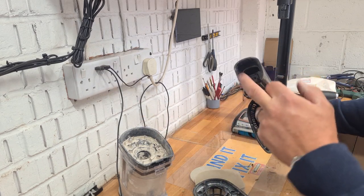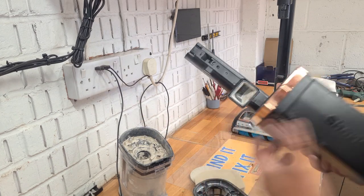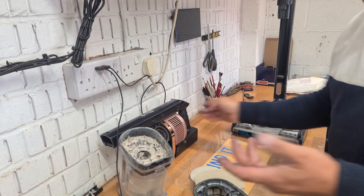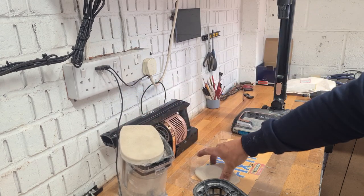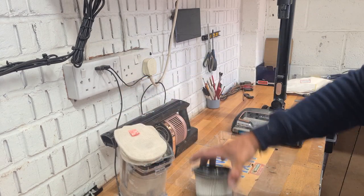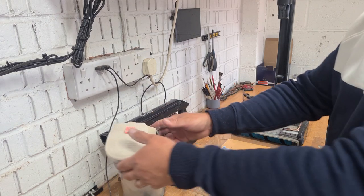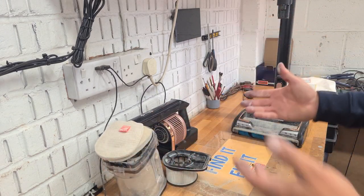You can just make sure this isn't blocked — there's nothing blocked in there. As we can see, there isn't on this machine, so that's fine. So these are going to need to be washed. Put them back there. That's a normal, common reason your handheld will lose suction and the battery just won't last very long.